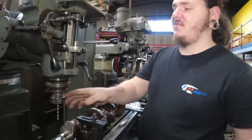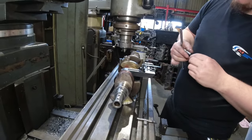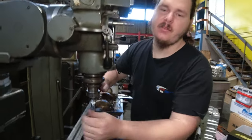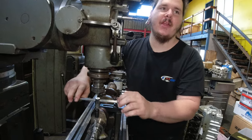And it didn't go through. Yeah. They put some grease in there too. It's just a bit of Molly Slip cutting compound. Makes it cut nicer, get a nicer thread, tap lasts longer. It's especially important on small taps like this, they're very easy to break.